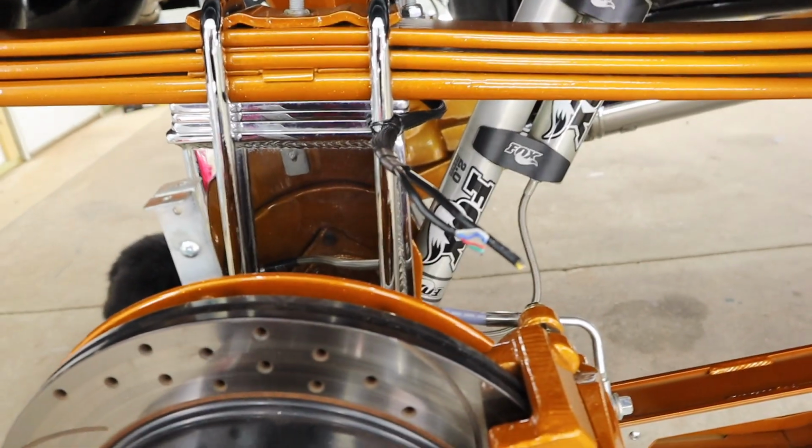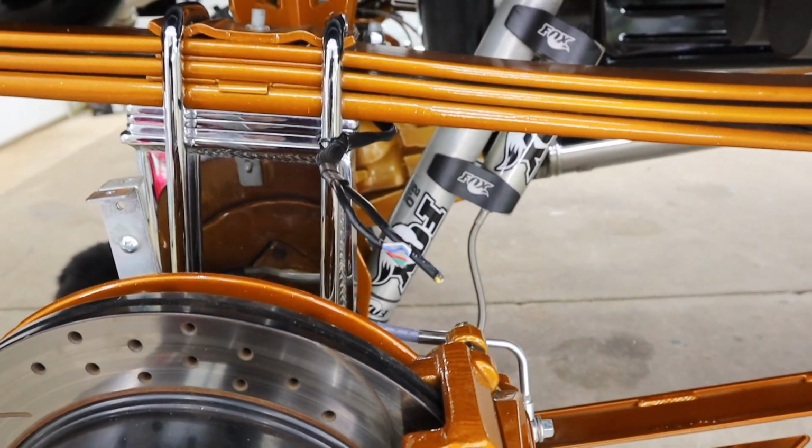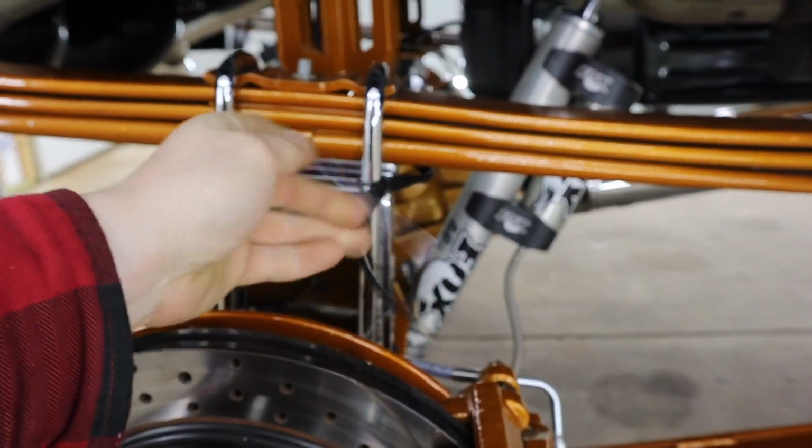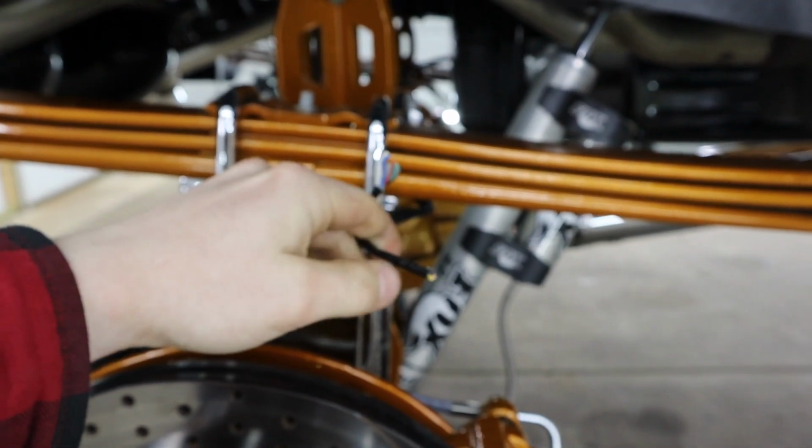All right guys, so basically the plan is here. So I thought at first I was gonna be able to just reuse this wire, but obviously that's not gonna be possible because this wire is way too small. That's basically trash. That's not gonna support anything. This is 22 gauge. That's also too small to support these high intensity, basically I'm doing quad row wheel lights. So each strip, I've done the calculations now, each strip pulls about 3 amps.